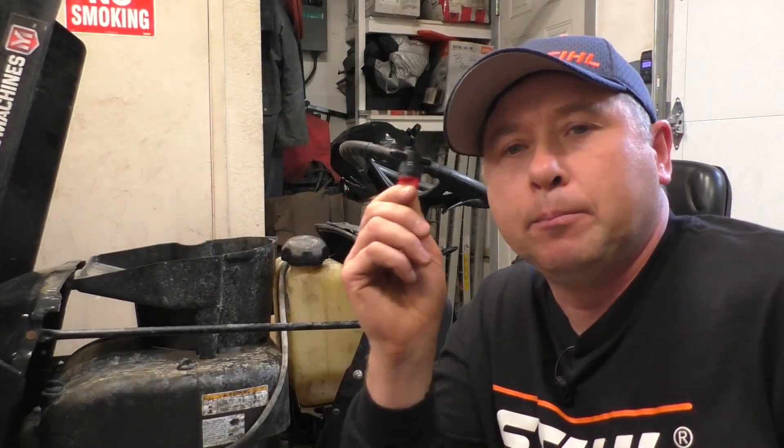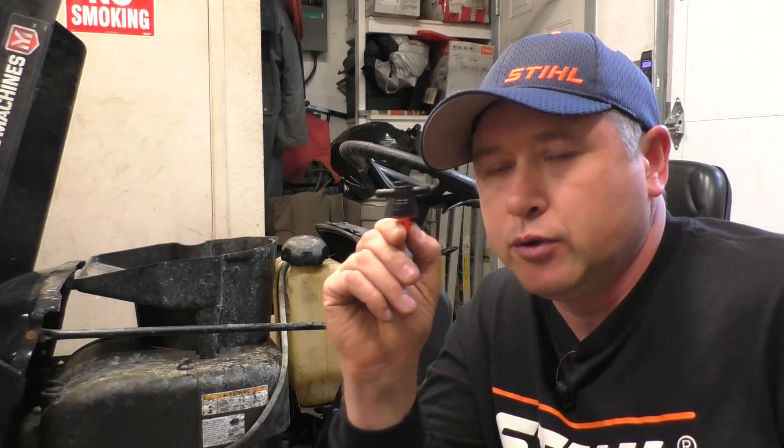The main reason I install valves on my equipment is so that I can run it dry. By doing this you're going to preserve your carburetor — it's not going to get gummed up in the spring. We put our machines away for approximately six months during winter, and there's a lot that can go wrong with fuel sitting in your carburetor that long. With a ten-dollar fuel valve — and again, buy the good ones because the cheap two-dollar ones will end up leaking — you can avoid all of that. Thanks for watching guys; if the video helped you, please like it, share it, and subscribe. You can also find me on Facebook, Twitter, and Instagram. Have a great day!